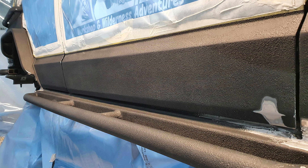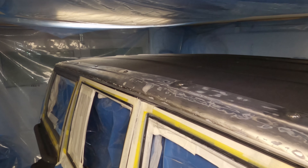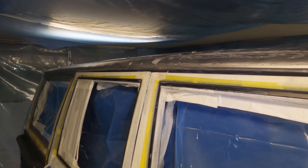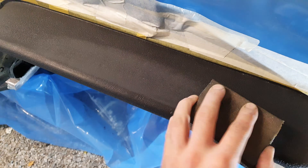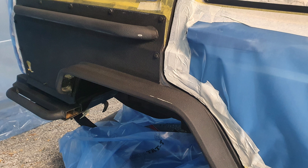Let's have a look at the vehicle, the prep work, and the surfaces. In terms of prep work, we've got a combination of spraying Raptor liner over existing fully-cured Raptor liner, and also spraying Raptor liner on standard factory car body paint. With regards to the existing Raptor liner coating, all I've done is taken it down with a sanding block — 180 grit first to take down the high spots, then 240 grit to finish and give it a nice matte finish. There'll still be little ingresses I can't get out, but that's not a problem as long as you've worked it down enough to have a decent surface to adhere to.